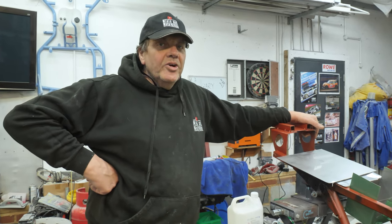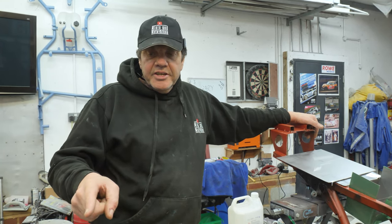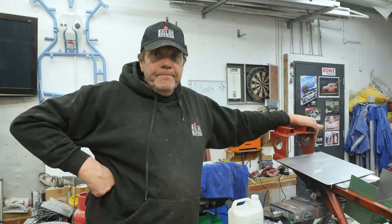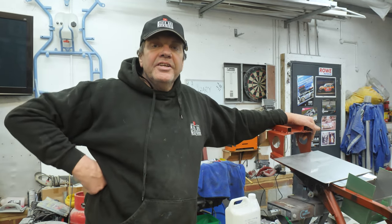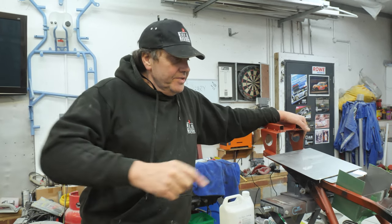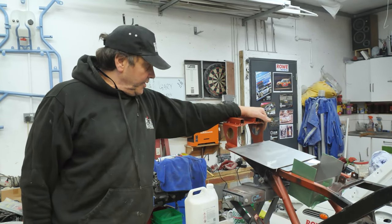I thought you were saying solar blast. No, it's soda blast. It's baking soda, bicarbonate of soda. Because then you can blast the engines and stuff like that, and all you have to do is just soak it in water and it dissolves away, so you don't get all the grit and horrible stuff left inside like you would with vapor blasting. Because the thing to do would be to vapor blast it, obviously, but then we don't want all the gunk and crap going into the engine. So if it's done with soda, the soda will dissolve away. Did I explain that well enough? You did. Perfect. But obviously the frame can be sandblasted and everything else can be vapor blasted.